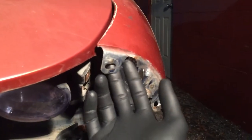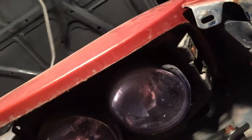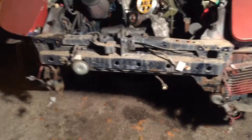The oil cooler is right here. What you have to do is take out your front bumper. There are three bolts right here — one bolt inside of here, one bolt inside of there, another bolt in here and another one in there. You can get them from the inside, and if you take out the black plastic pieces for the headlights it makes it a lot easier. Do that on both sides to take those three bolts out, and there should be some bolts here as well. Once you take those out you can take off the bumper.